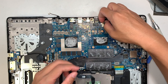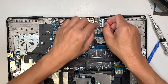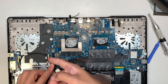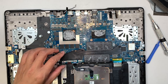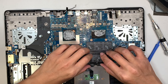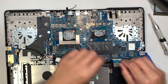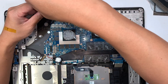Here comes the LCD screen. You see this little plastic here — peel it to the back so the connector is exposed, then flip the connector up, slide the LCD cable to your right, and that's how you disconnect the LCD. This is the CMOS battery — set that aside. Next, open the connector and slide it to your left — that's your USB I/O board on the left. This is your keyboard lighting; open the connector and slide the key cable out. Then your touchpad and keyboard cables. Finally, the speaker — slide the connector down. That should be it; we are removing the motherboard.